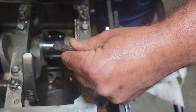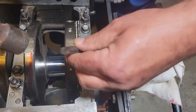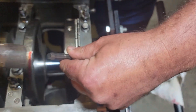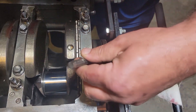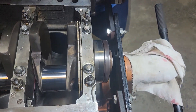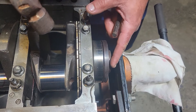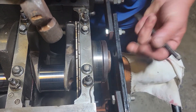Some of these really get stuck on there, and if that's the case you might actually want to pull the crank so you don't damage the bearings — but that's up to you, you can take the risk if you want. Now it has to come over a flange.